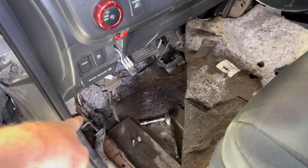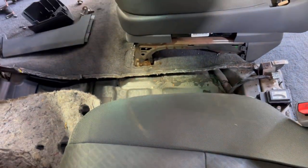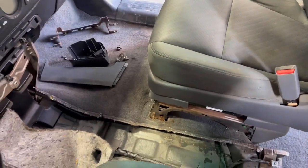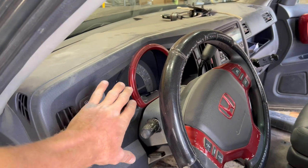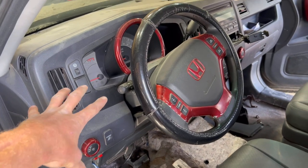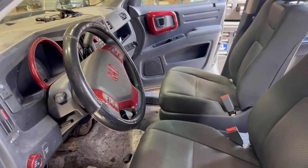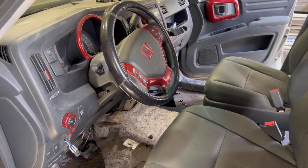What I have going on is I've got to repair the hole that's in here first. But we're obviously going to have to make room for the shifter for the T-case. And we're also probably going to need to bevel out and cut this area for the square body's drivetrain. We're also going to have to make a different cluster area for the wiring harness, and figure out how to get the gauges from the square body's harness. I also have to figure out how to connect the power to all the interior wiring so that the windows and everything else works. That's the goal.